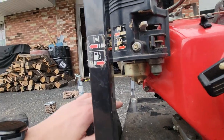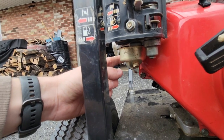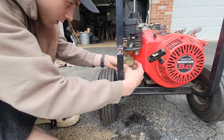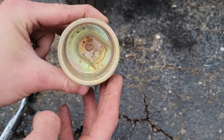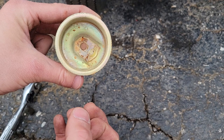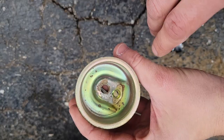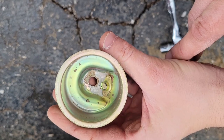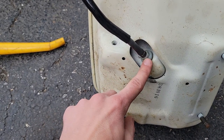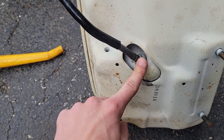All that gas is drained. The last thing before throwing everything back together is to take off the sediment bowl — Honda calls it that, but it's basically the float bowl. I want to see how much crap is in there to gauge the carburetor's condition. The float bowl came out completely dry with debris floating around in it — glad I'm cleaning this out. The corrosion that remains is just what it is. I also found a filter on the bottom of the fuel tank and pulled it off — it actually looked really good, so the fuel tank is going back on.